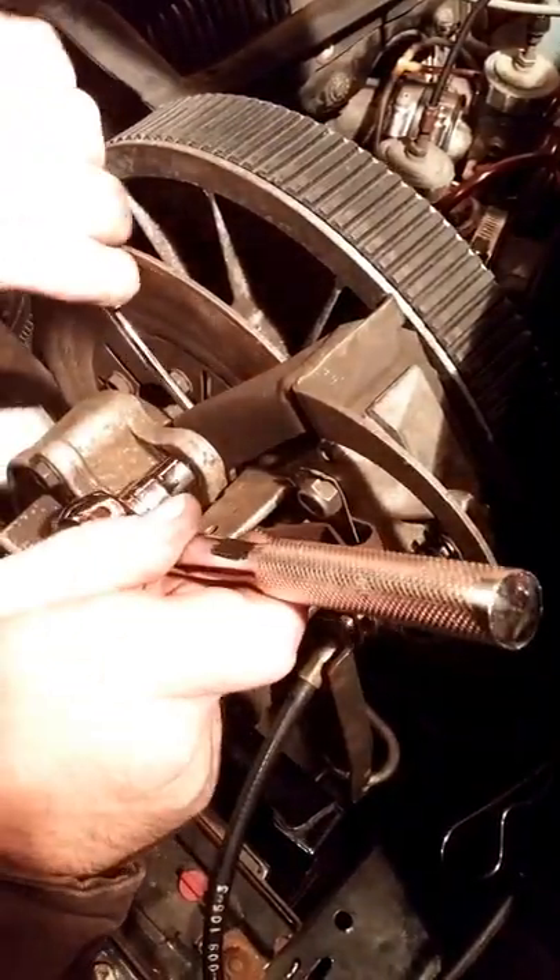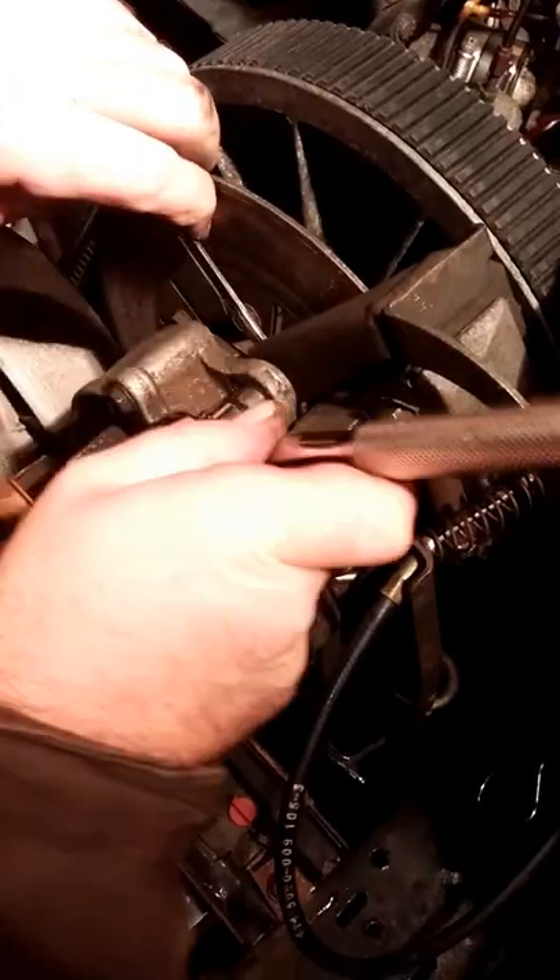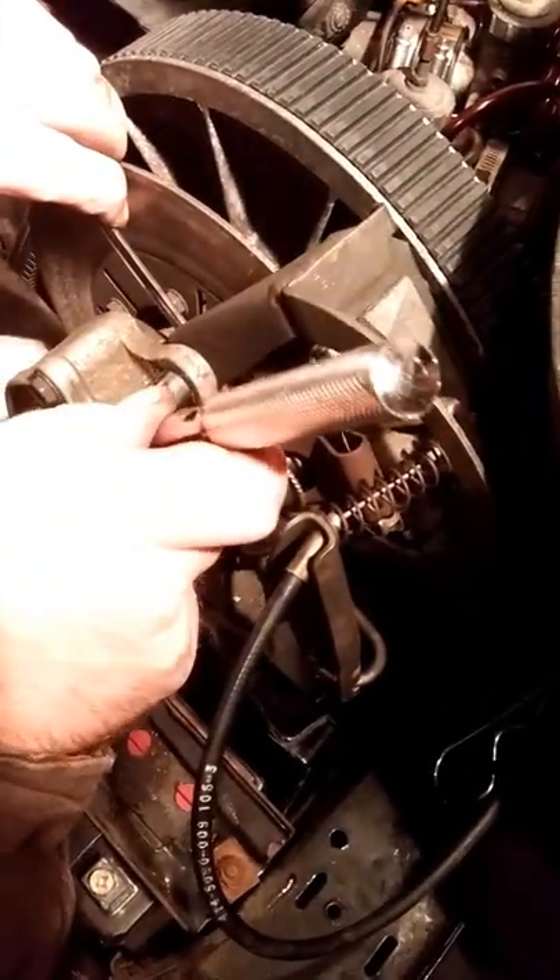Mount it like that — these bolts will mount back on the chain case. We'll put this pin back in here, do some adjustments, and we'll get our brake working again. So we've now remounted the caliper. These are the two mount bolts that hold the caliper mount here and we're tightening them up — there's one and another one down in here. Get the open-end wrench and get it back in behind there.